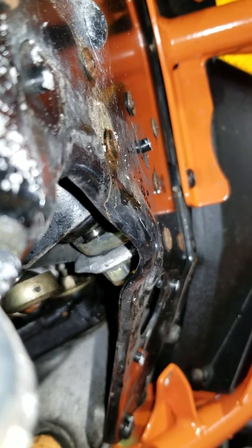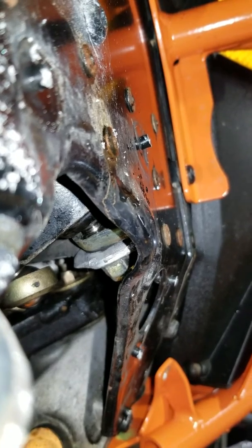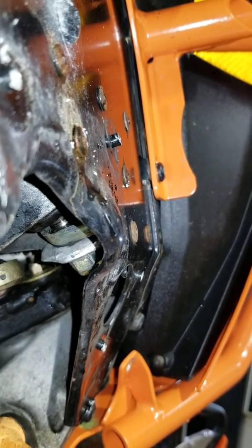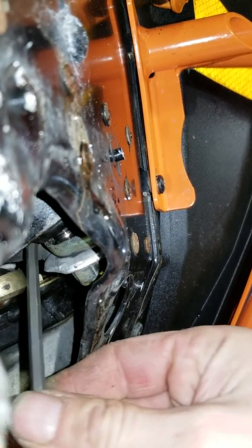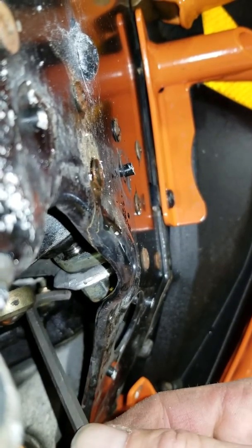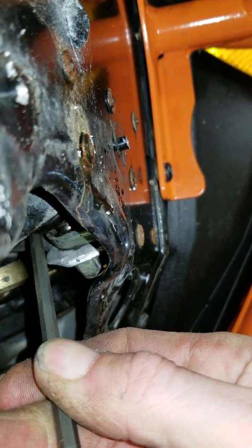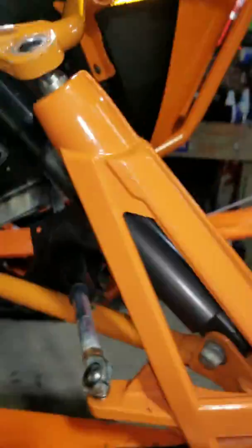With the ridge on the plates there's no way of getting a wrench down in there — not enough room on the left side of that post as you're looking at the video. I just stuck an Allen wrench up in there, looped it back around this way, then twisted it downward until it caught and hung on to that shaft enough. Pushed the plates back together and cured the sloppy steering on my XF 800.